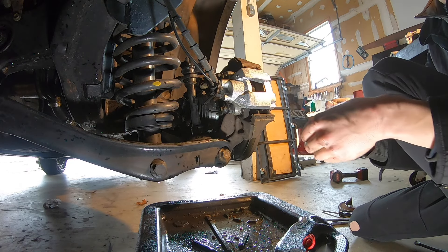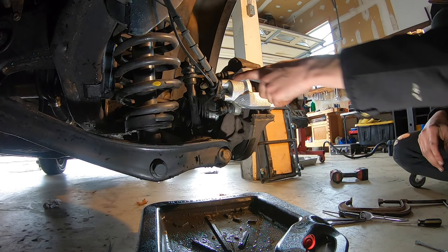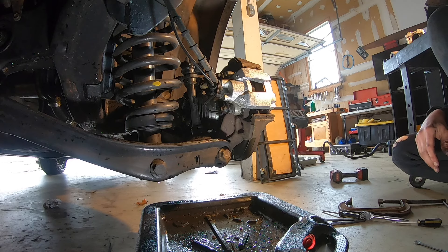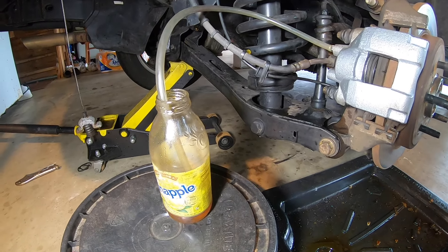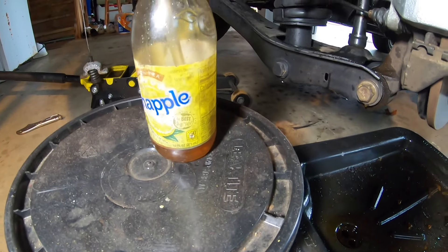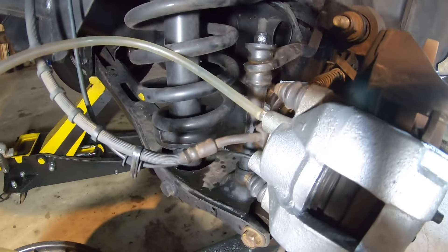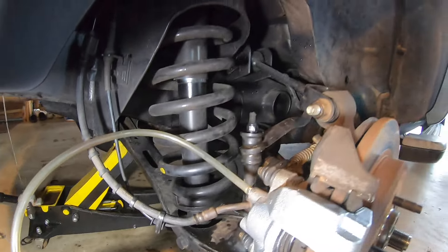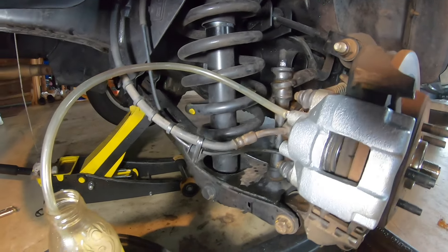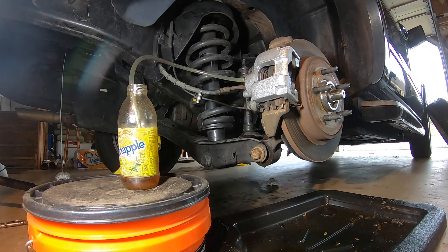Clip our harness back into the hose. Now I'm going to show you how I do my one-man self brake bleeding procedure. I use a Snapple bottle — it's still glass. You fill it a third of the way with brake fluid, submerge a hose with the same ID as the bleeder screw, put the hose over the bleeder screw, make sure the hose is higher than the bleeder screw because the air will come to the top. Then you go into the car, turn the ignition on, don't start the engine, and just start pumping the fluid out. Make sure you keep an eye on the master cylinder and add fluid if you have to — you don't want it getting too low.